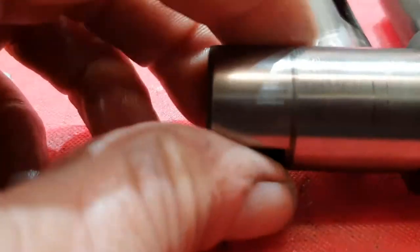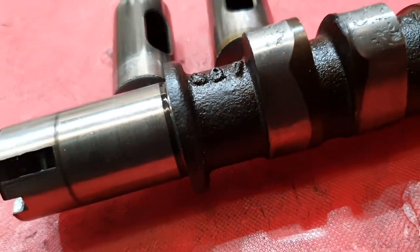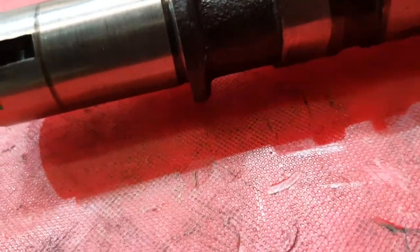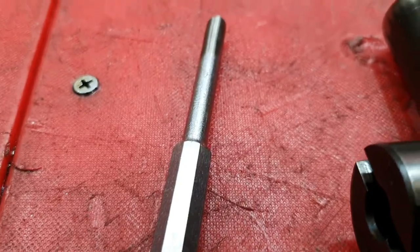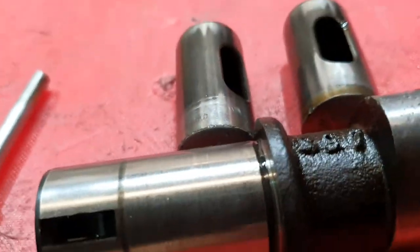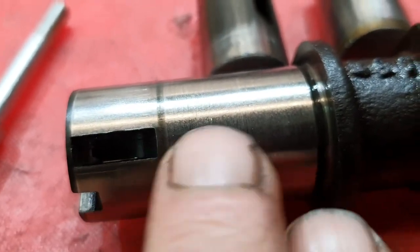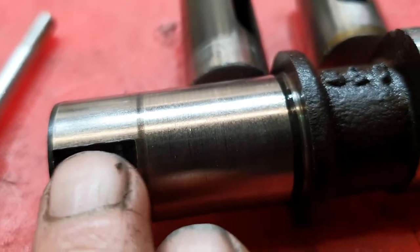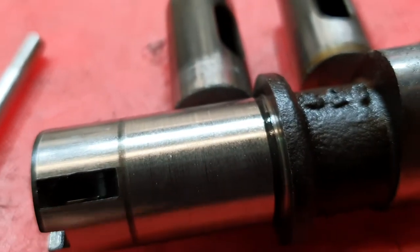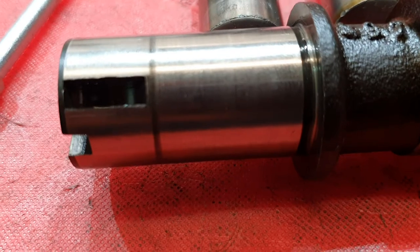Same thing — new camshaft needed. The sprocket was okay because the bearing and keyway weren't hammered, so everything came out and you just tap the Woodruff key out with a little drift — a very light hammer. Get the drift under the end of the key and just tap it very gently, and because it's got a curved bottom it'll just roll out eventually. Then you tap it back all the way in and get it nice and flat. It should be an interference fit.